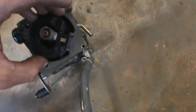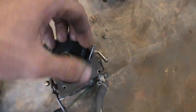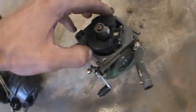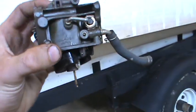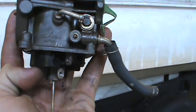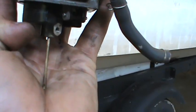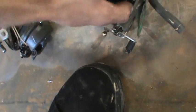There's a little pin that goes in there. In the running position, gas can flow in and as it fills up the bowl it goes up and up until eventually it stops — it plugs that hole with that little needle and now gas can't come in. It's doing this cycle constantly: down and up, down and up as you use the gas. That's what's called the float. That's one thing you want to check on your carb — make sure the gas is actually flowing in.